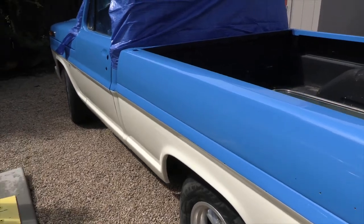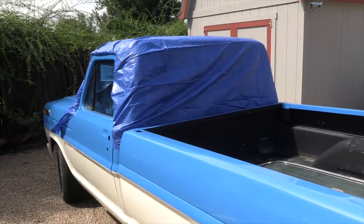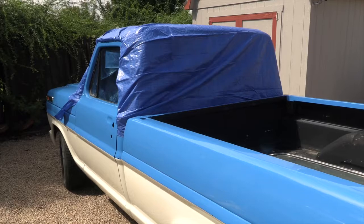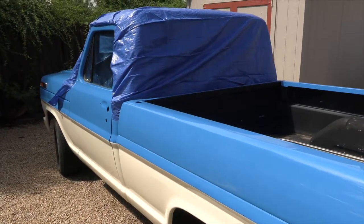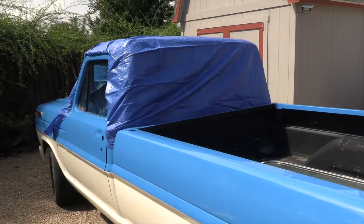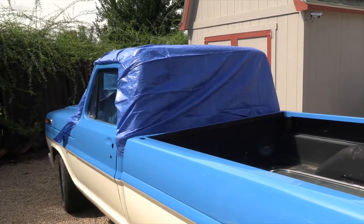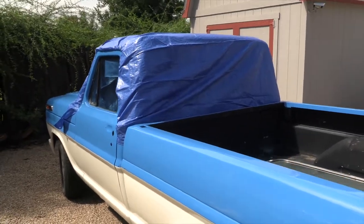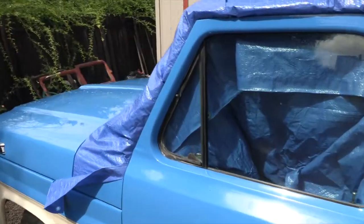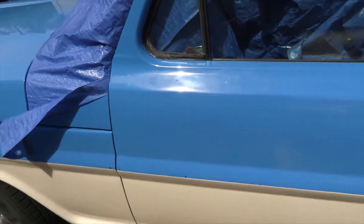There's no glass in it right now and it's been raining on the top of the cab, so there were some body work issues there that Colin took care of. When we bought this truck, someone had put a sunroof in it, so I actually cut the cab top off and put another cab top on it when I built it. I couldn't deal with trying to weld that hole off — it was never going to be right — so putting a roof on it was the best solution. The area that needed to be addressed after paint had nothing to do with putting a roof on it.